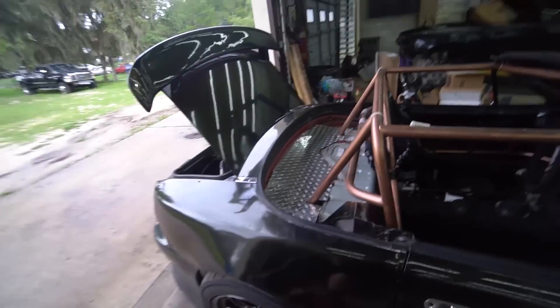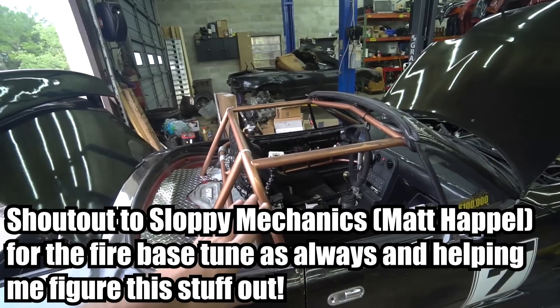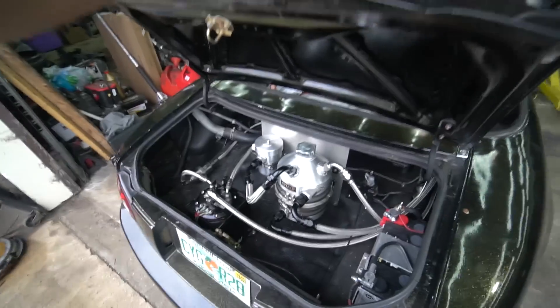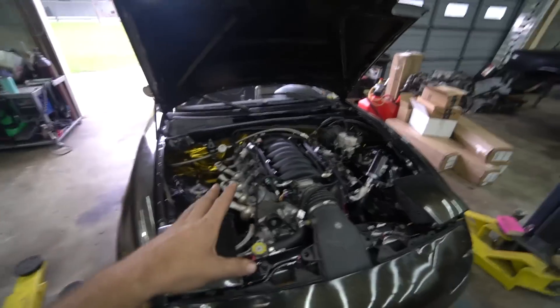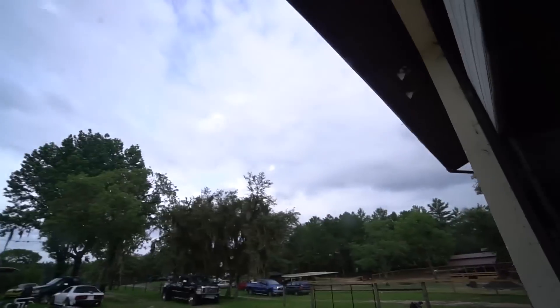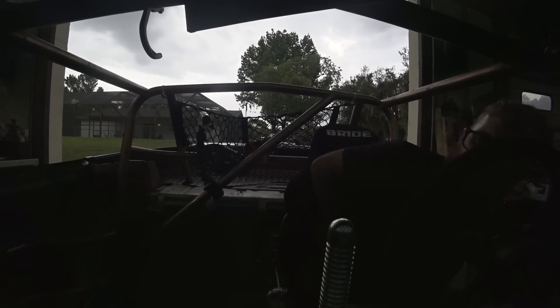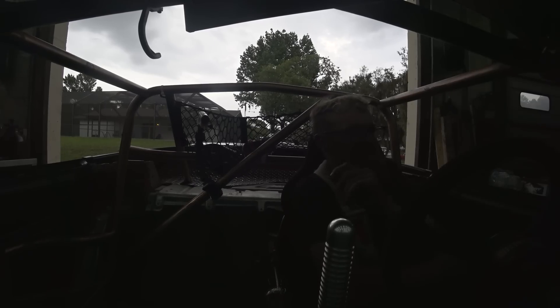It's only in the back little corner now of the flange, but it's still leaking a tiny bit on the other side too. I figured out the idling thing - basically I just had to change the ramp to say like 0% throttle, have the throttle blade open this much. We will have to go back and do that again with the new throttle body so I didn't put too much time into it, but I've got it idling good. Oil's full, fuel system seems to be working, seems to be running good, fans work. We're going to go drive it. We've got a break in the rain - every time I was about to drive it, it started raining. We've got to take our chance, shoot our shot, go drive this thing. Obviously it's not going to be the best test drive because it's wet, but I'm sure we'll get an idea of how rowdy it's going to be.